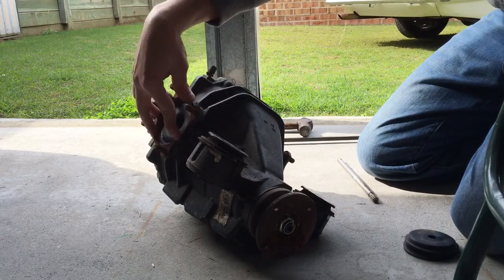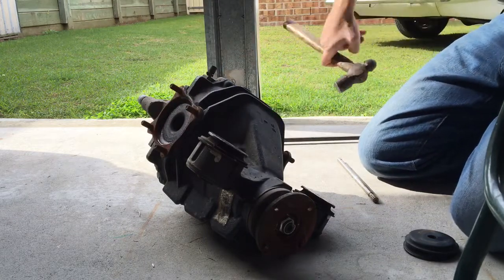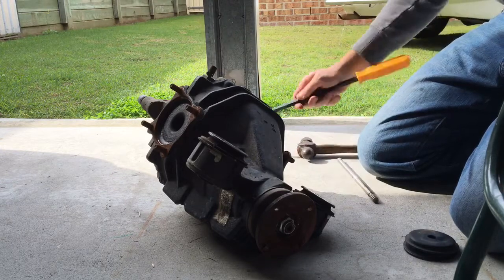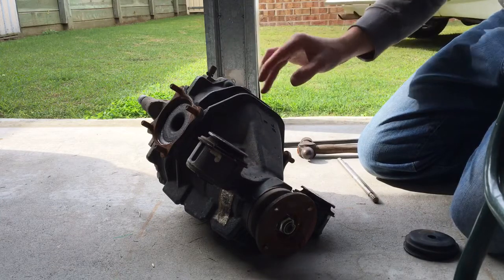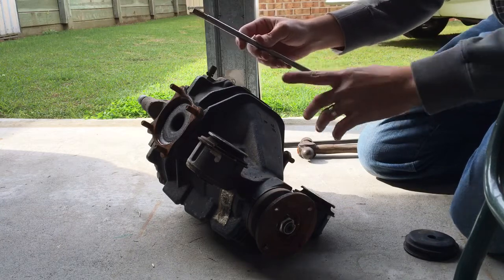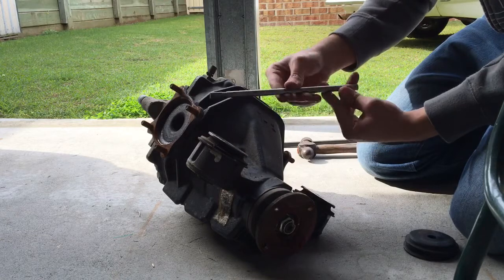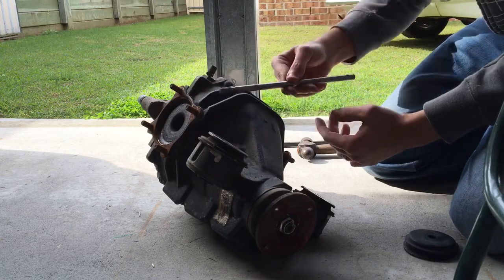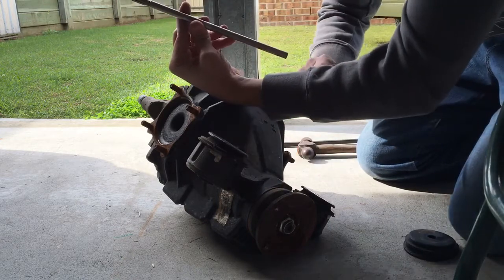This video is to quickly show you how to remove these side shafts. What you need is a hammer and a lever bar. If it's a bit tight with access points, just something you can hammer onto - like a drift or something like that. This is just a stainless shaft so you can get a different access point if it's in the car.